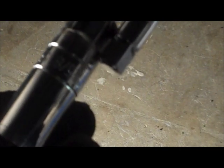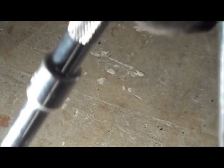So just a little trick on the second spark plug on the right rear bank, or right bank. I use 2 extensions here, 2 short extensions, and the 5/8 socket, in order to get into that space, because you've got the muffler and muffler mount that kind of limits the space that you have.